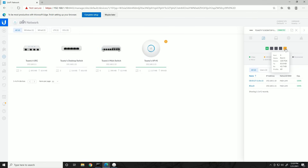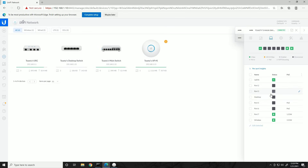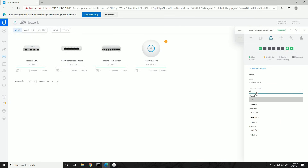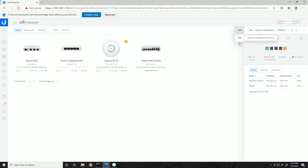We move the red cable to our PC from port 4 of the main switch to port 5 of the new desktop switch. The changeover was nearly instant. In the Clients tab of the desktop switch we can see the connected devices — one PC on port 5 running at 100 Mbps because of my network card. On the main switch, port 4 (named 'Desktop') now has nothing connected. We'll go to the Ports tab, remove the name from port 4, and rename port 7 to 'Desktop Switch.' We'll assign it the profile 'Main and Internet of Things' since we don't plan to have any guests hardwired to this desktop switch.